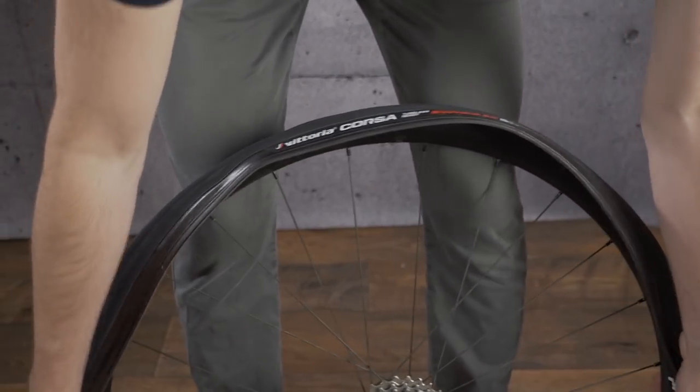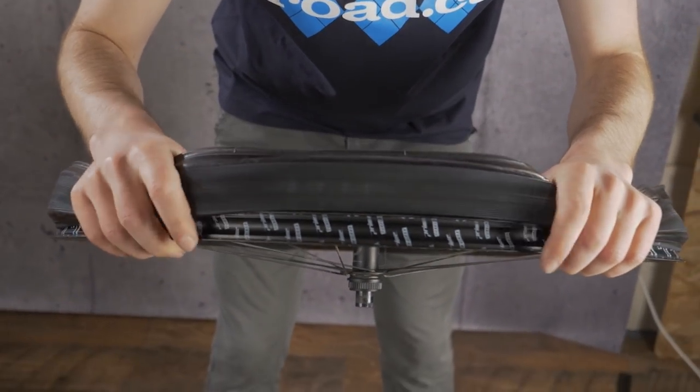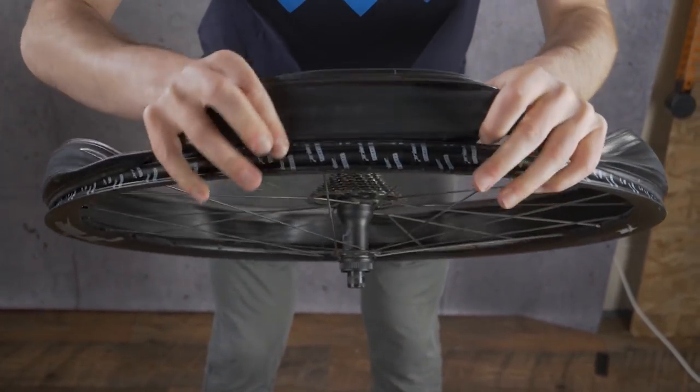When you've got the tyre onto the rim, it's not all over. In some cases you need a tubeless specific pump, CO2 gas canister, or compressor to deliver the big burst of air needed to pop the tyre up onto the beads. Much of the problem with tricky tubeless installation comes down to compatibility between different brand rims and tyres and a lack of a universal standard. The wide variation in rim and tyre size and bead stiffness affects not only installation but also safety. Keeping the tolerances small is crucial because without an inner tube pushing the tyre bead against the inside of the rim, there needs to be a really good fit to ensure the tyre doesn't blow off the rim.